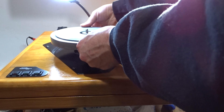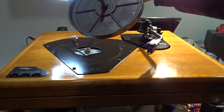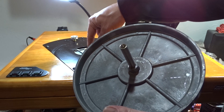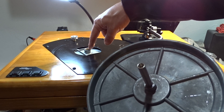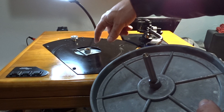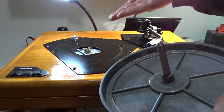This just pops right out of the bearing. At some point or another, these were slightly notorious for having bad bearings in them. This particular type of bearing for this platter uses a quarter-inch ball bearing that sits down at the bottom of the well in the shaft. This didn't come with that quarter-inch ball bearing, so I had to source one out. What I ended up choosing was just a regular steel ball bearing for now — there are a few others I have. Eventually I'll probably order something with a smoother texture, but it's stainless steel — it's about as smooth as you're going to get for 30 cents.